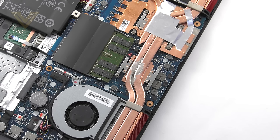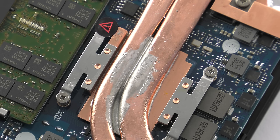We come to the CPU first of all, and so our laptop is based on AMD Ryzen 7, and it is the 3750H, which is a 4-core, 8-thread processor, which has a base frequency of 2.3 GHz, and a max boost of up to 4. And so that CPU isn't quite on par with the mainstream Intel 8750, or even the newer 9750, which are both 6-core, 12-thread, and they utilize higher clock speeds.